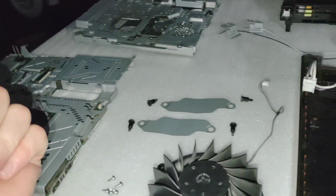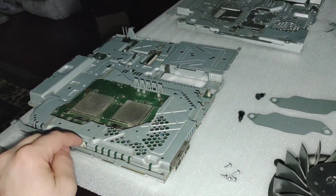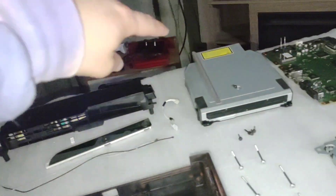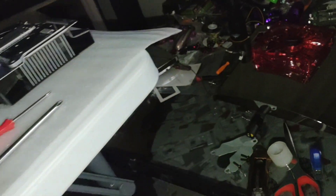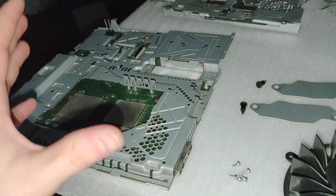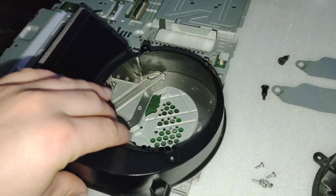That's one of the very few mods you really have to do besides cutting something to allow tubing to come out, because you simply can't do a fully internal on the slim. We've got our custom painted shell here, so all we need to do is put the screws back in, put our thermal paste and heat sink on, and then get ready to put this into the shell and start assembling everything. We want to keep the same power supply, power eject button, and blu-ray disk drive with this motherboard, and use the other disk drive, power supply, and everything that originally came with this other motherboard.